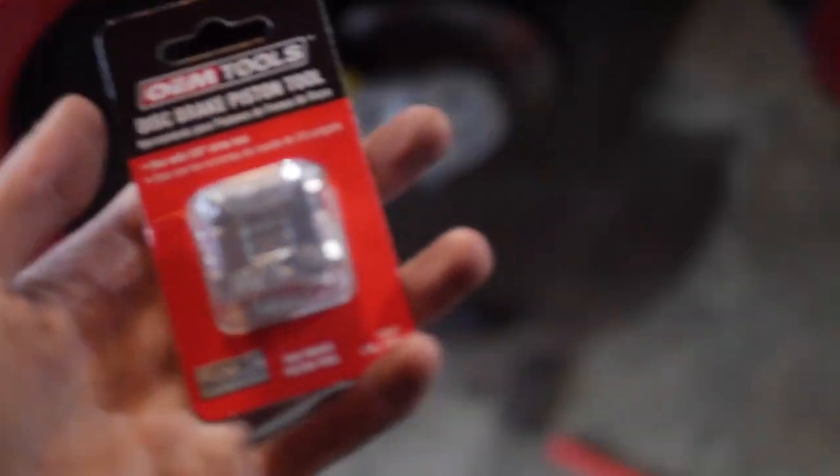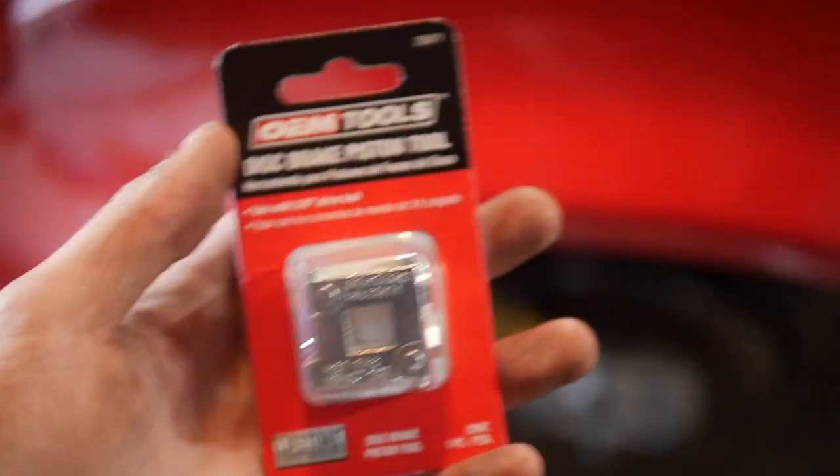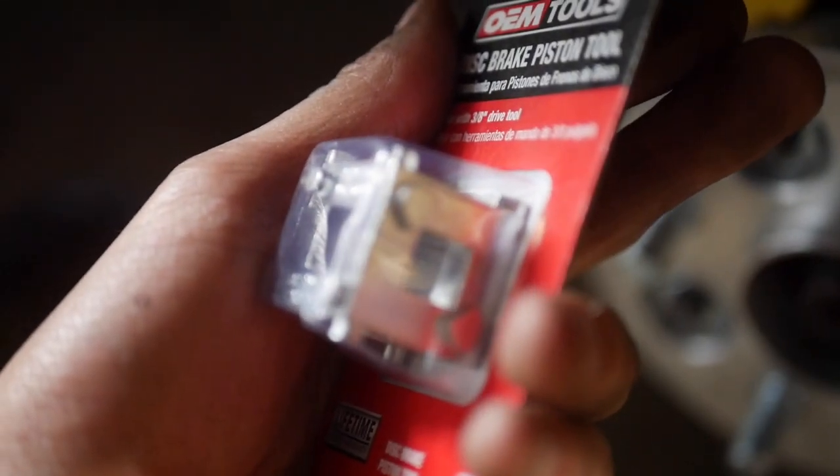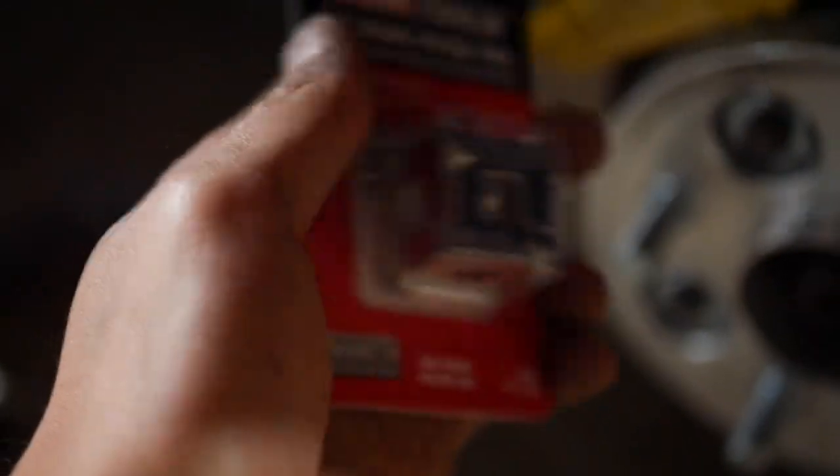The reason I picked up this new cube tool is for the rear brake pads. Unless you have a brand new caliper, you'll need this. Inside the piston there are little slots — usually you can just push it with those slots, but basically it gets seized. So you get this tool and it fits into the two notches, and you use a three-eighths drive to turn it — that's how you push it back because the new pads are thicker. Let's go ahead and use this and I will be done.